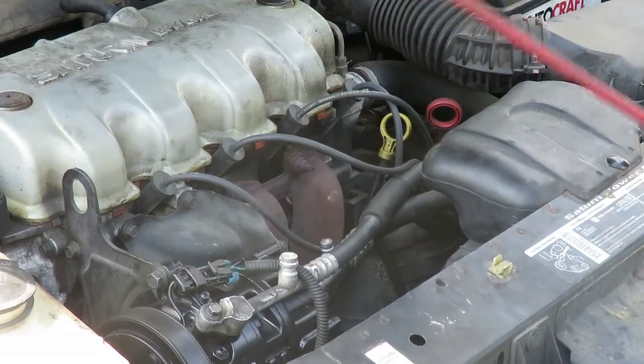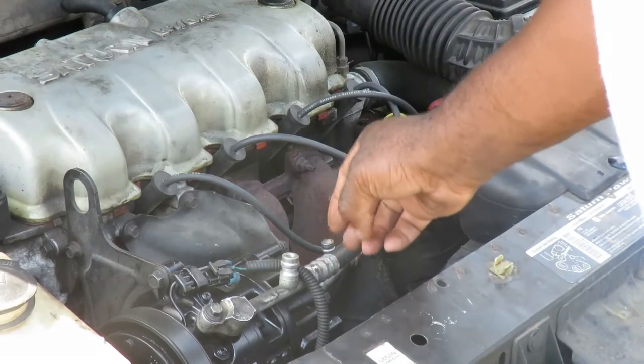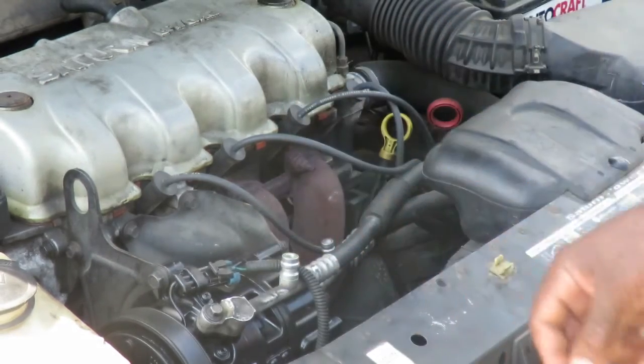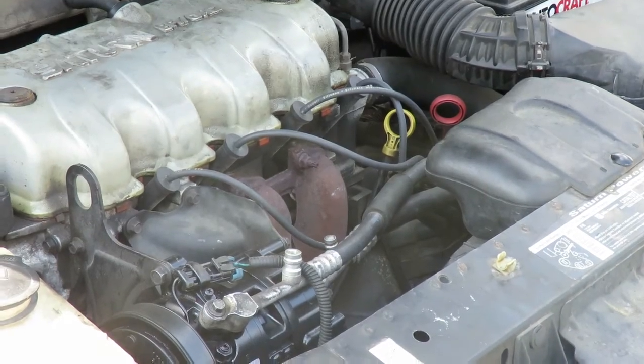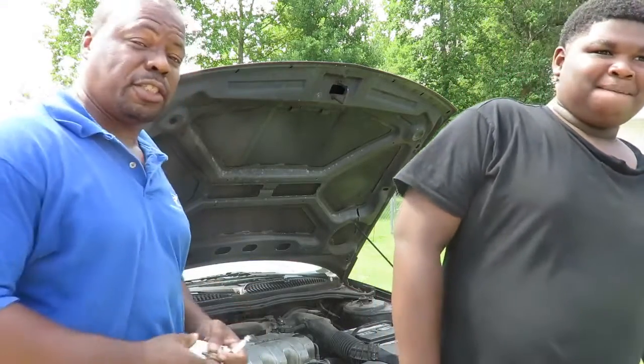Okay, be very careful. Disconnect the high side. Hook it up, turn your tank back over. Shut it off. Now there should be caps on this, especially because sometimes these vehicles leak a little bit. So we're gonna make sure we get some caps and put them up here. Alright, there you go. That's how you change the AC compressor and recharge the system.